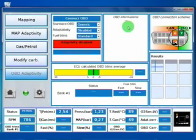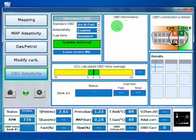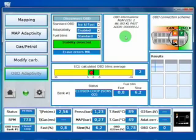To enable OBD Adaptivity, we have to click this, connect OBD. This must be done with the engine on, or at least the key on. Now the ECU is checking which standard is the right one for this car. We have an ISO car here, so the standard OBD that is detected automatically is ISO fast.